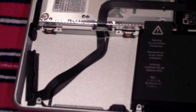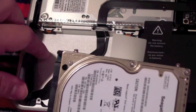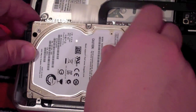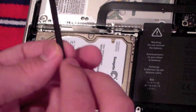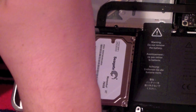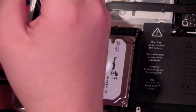Once you replace the screws, take the new hard drive with the tape, flip it so the tape is facing out, and plug it back in. Now working in reverse, gently place it back in the housing. Take the bracket and put it back in place, then switch back to the Phillips 00 and screw it back in. Make sure you touch the metal before doing this, because if you have electricity running through you, you could seriously damage or break the motherboard.